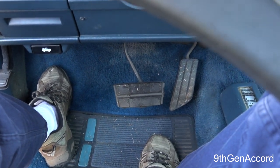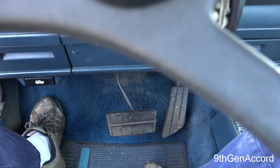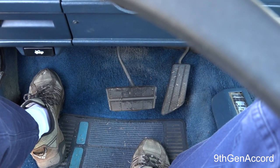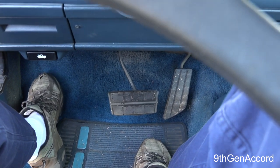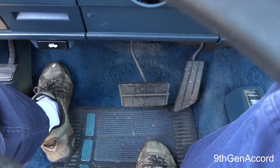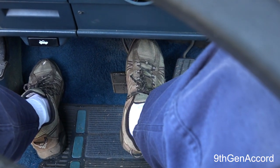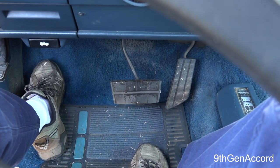Alright guys, I hope that was helpful. Remember, if you choose to disable the anti-lock system on your vehicle — whether it's front, rear, or both — do that at your own risk. I was just showing you what I do. I like a firm pedal and I did not need the dump valve, which was actually defective and making the truck dangerous to drive. The truck now has really good brakes. Thank you, and I'll see you on the next video.